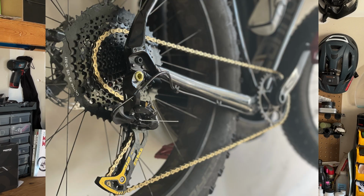variability on that site. I've actually ordered a handful of other components for the fat bike. I figure, hey, I've got some parts in the parts bin, so I put carbon bars on it that I had, put new platform pedals, going to put some more sealant in the tires, and I actually ordered a new 12-speed cassette that has compatibility with an XD SRAM freehub body, as well as a 12-speed derailleur and shifter. I don't have any experience with the brands. They're like LTWOO and Sunshine. That's the risk that you take with AliExpress.